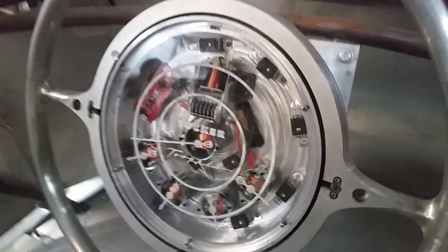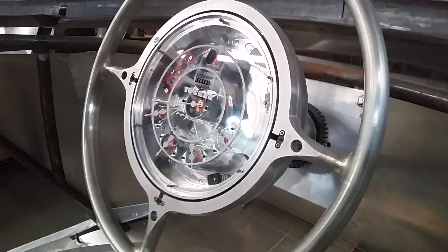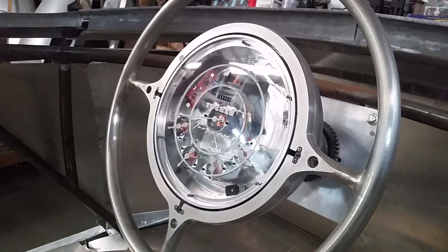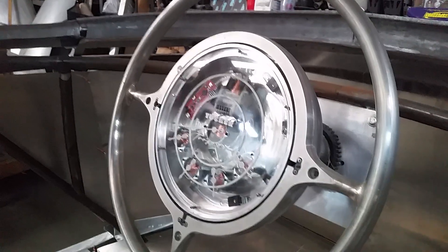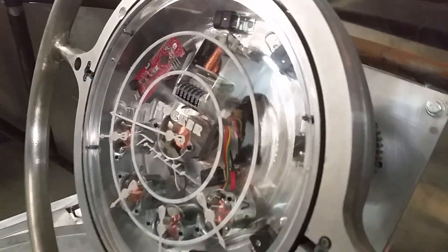The Arduino handles the turn signals — you can see the switches on the two sides. The signals are analog inputs for some reason. There's a mechanical odometer because they didn't want a digital one, so the Arduino takes the signal and tricks the odometer. And there are no wires — they made it RF, with an XBee module on the back of the Arduino unit.